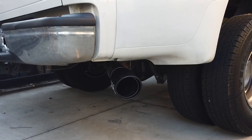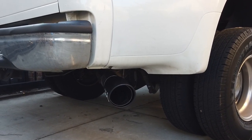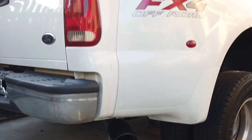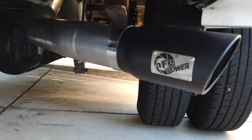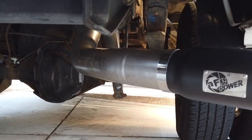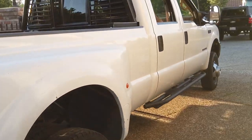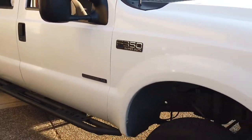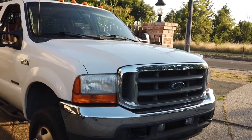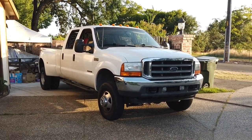Maybe I should have gone with a slightly bigger tip — I think that's a 6-inch; maybe I should have gone 7 or 8. But we don't want to look too obnoxious, and it still looks really good. Everything is still in place, nothing's falling off. After I drive the truck for a little bit I'm going to test all the clamps and retighten everything — downpipe and all — just to make sure everything's lined up. I removed all the sticks and little spacers, so nothing is rattling or hitting so far. It's good to test after driving for quite a bit.